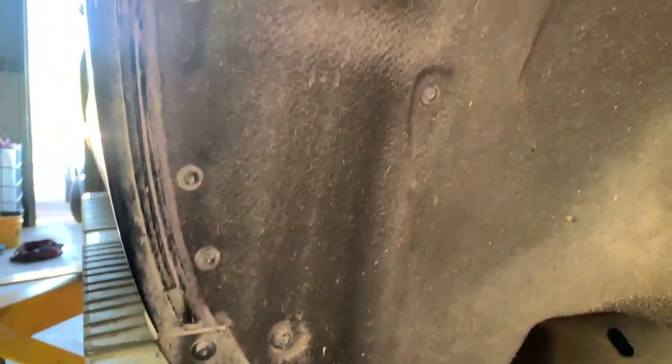The wheel liners go back in with all the bolts in place. There's a tab that has to go behind the fender — right there — and it has to sit inside on both sides, driver and passenger. Put your wheels on and make sure you torque your wheels — I think the torque spec is around 150.